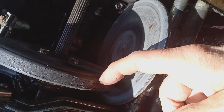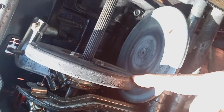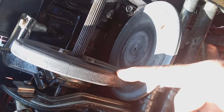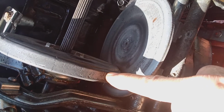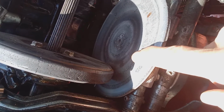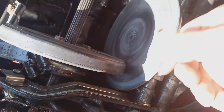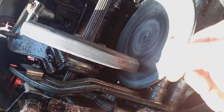Right now, it could also be out of adjustment. In some cases, if you're not driving, it's out of adjustment where the wheel is not contacting your drive wheel here. I'm going to show you. You see how I'm moving the drive wheel and it's moving your friction disc.